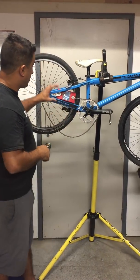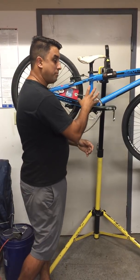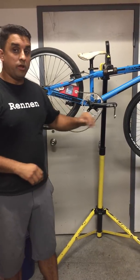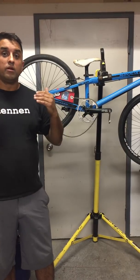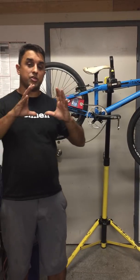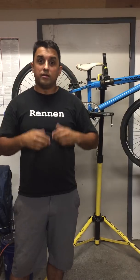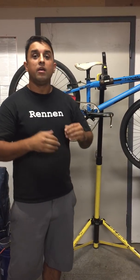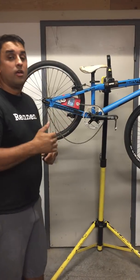Recently I thought about picking up a digital scale which is going to actually measure the chain force. We're going to put two different decimal gears on — a 43.7 and a 44.2 — and measure how much force is shown in the chain between those two gears when we hang the same amount of weight from the crank. The 43.7 and the 44.2 both have 44 teeth but they're machined differently such that the chain rides higher on the 44.2 than the 43.7. If this theory is correct, as the chain moves out on the circle, the force actually goes down, and when you move in the other direction as with the 43.7, we should see the force go up.